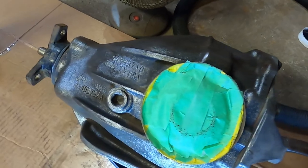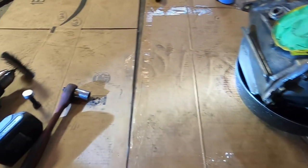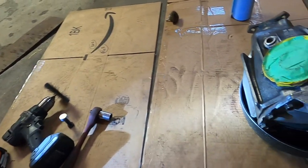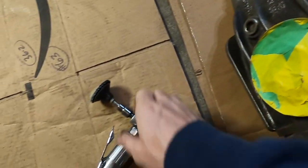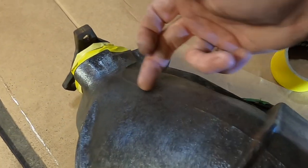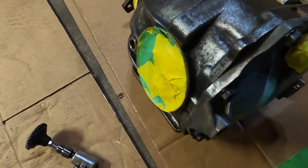I got the case all shone up — you can see 'Made in the USA,' which is kind of funny putting that on my German car. I just got the drain plug out because the auto wrecker drained it out and put it back loosely, so I got to reseal that anyway. I'm going to take this a step further and use this 60-grit flap disc to smooth out some of these casting marks — mostly for cosmetics, but it does actually increase the strength of the case a little bit.